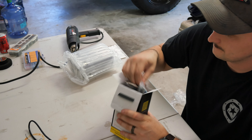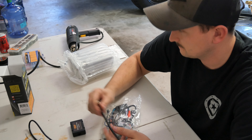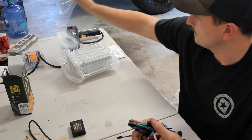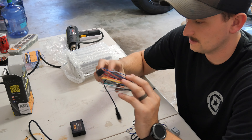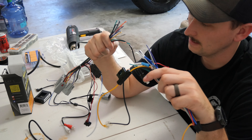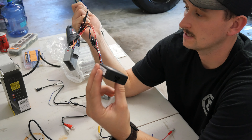Next, we're going to have our factory steering wheel control interface. This is your antenna extension for AM/FM radio. And this guy here — it's looking like it's going to have everything on here. Hypothetically, all of this should plug into this, and then we'll make it neat and tidy. This plugs into the factory connectors on the steering wheel control side. This plugs into the factory connectors with this in-line to retain factory steering wheel controls.